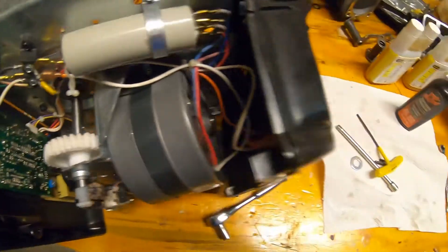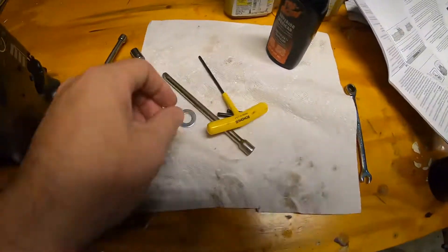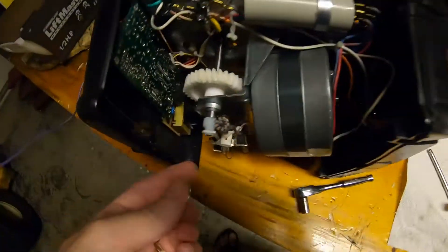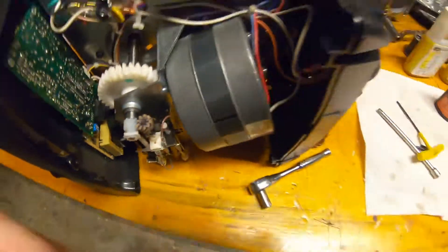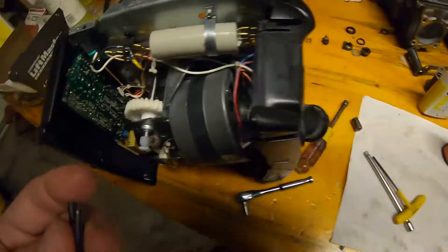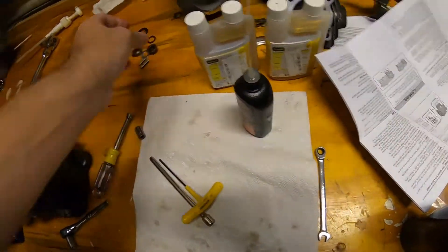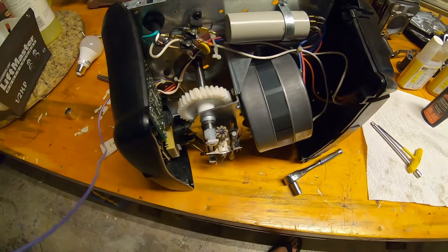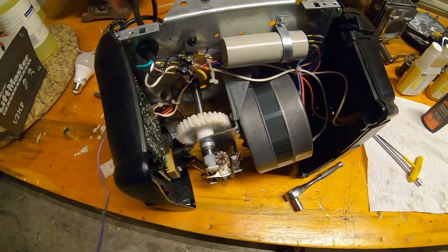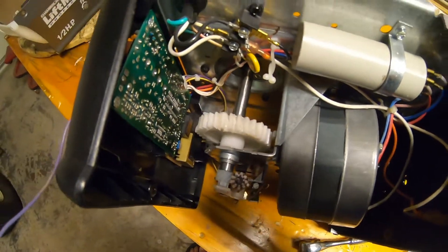Here is the semi-finished product. The only parts left over are from what the kit supplied — which is a good thing. There was an extra washer in the kit because there are different spacer thicknesses, so I just matched the thickness of the new one with the old one. There are also new roll pins — not sure why they gave us those, but maybe they're just not needed in this particular opener. So I think we're ready to assemble this back onto the ceiling and give it a test with no chain hooked up, just to make sure everything runs okay. We'll cycle it back and forth, put a lot of grease on the gears, and then if everything goes well we'll hook it back up.